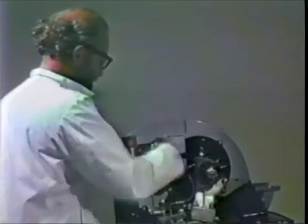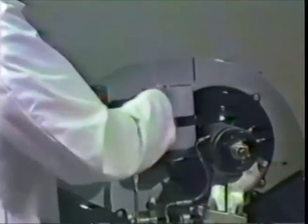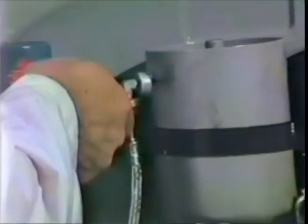All right, 12mm wrench for the oil filter lines. Tighten them down. Don't overdo them or you can bend or break things. But you do want to get the ferrule inside.